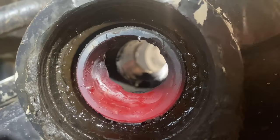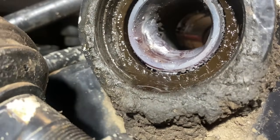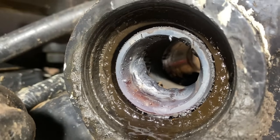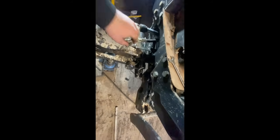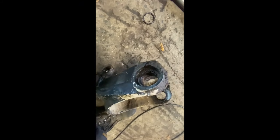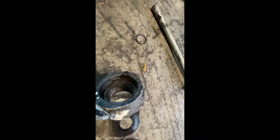With some welding done to the bush, we've got it lovely and hot, so that should just pop straight out - though sometimes it doesn't. I'll shove a bar in from the other side, hit it with a sledge, and if everything is hunky dory that should just fall out. There we go - came straight out. Now I should be able to lift the top wishbone arm off - there we go - and do our bushes, put back in the center bush and back in our pin.